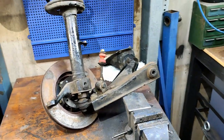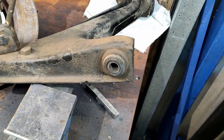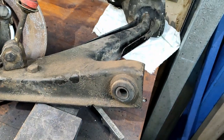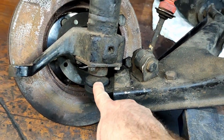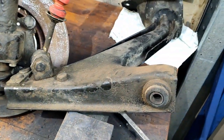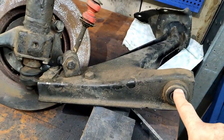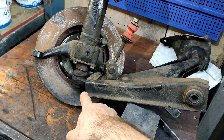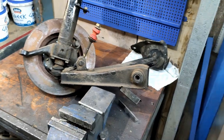While I wait, I'm looking at changing some of these suspension bushings. I do have these — I ordered them like six years ago but just haven't done it. These are shot, as you can tell; they're all perished, probably original with the car. This one is perished as well, again probably original. The rotors are rusty but they'll clean up after the first drive — I'm not worried about that. I'll probably order some new ones later, but for now they'll do fine. I want to change this, this, and the bushing in here. I have the bushings. I don't have the ball joint yet — OzPost again.